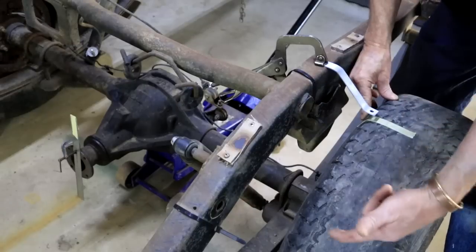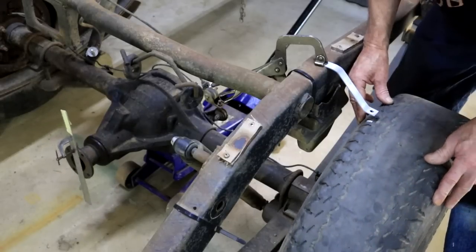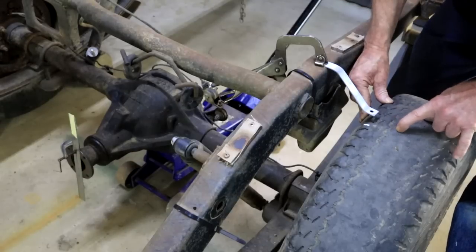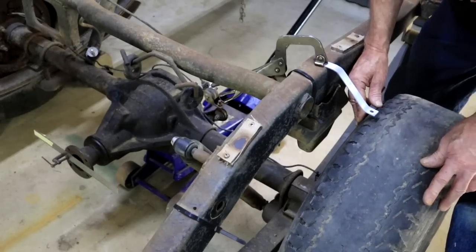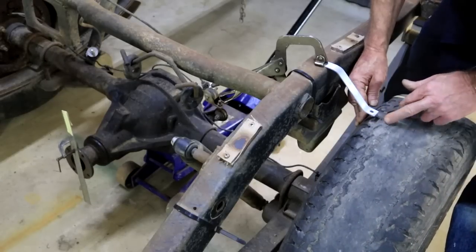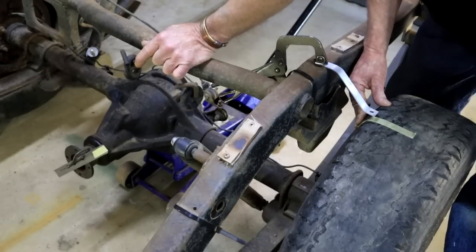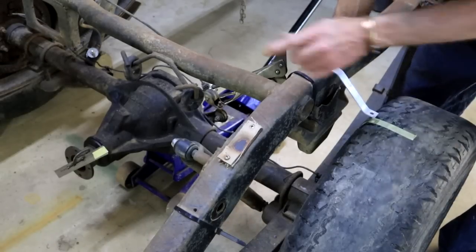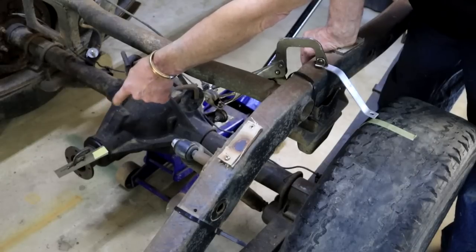With both marks lined up, I've clamped a ruler on the input flange in a vertical position. If your prop shaft is still on, you can make a mark with masking tape or a paint pen — as long as you've got some kind of reference. Now we'll see how the ruler rotates as I turn the wheel. Doing one rotation of the wheel, I can see the differential input turns more than once — it looks like about two and a quarter rotations.